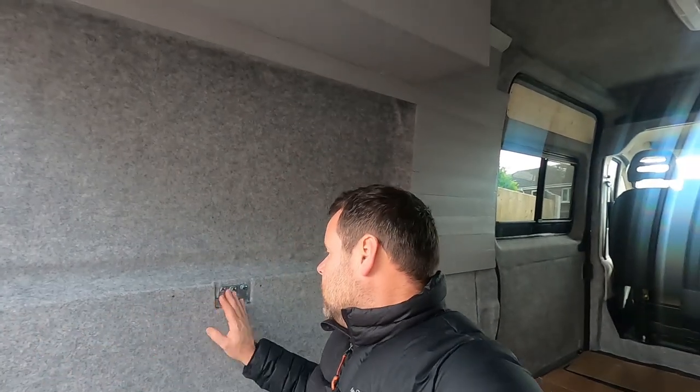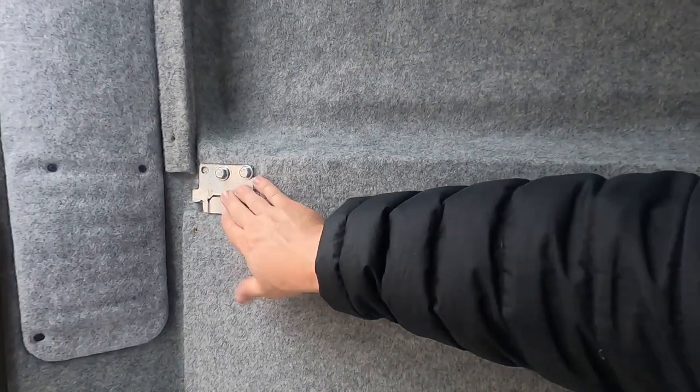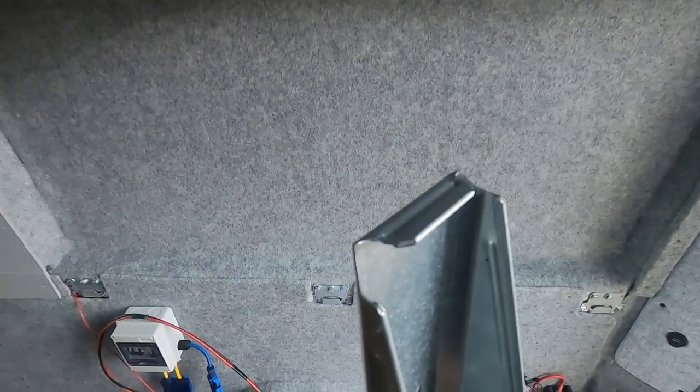You're probably going to see three lots of these throughout the build. The bed I'm using is pretty much all from IKEA — they're called Skorva beams and Skorva beam brackets. They're telescopic sliders which go all the way across the length of the vehicle, and they're actually off a bed as well. I'll link everything in the description so you can have a look at the parts I've used. The first process was getting these Skorva beam brackets fitted on either side. The beam itself just sits in the bracket, but I am going to put a screw through as well because they feel a little unsteady. Let's start getting these beams slotted in — we'll have to get the slats in first and then screw them in after.